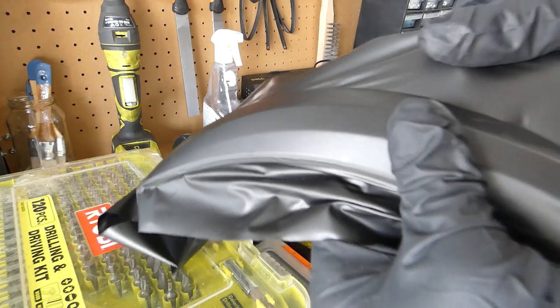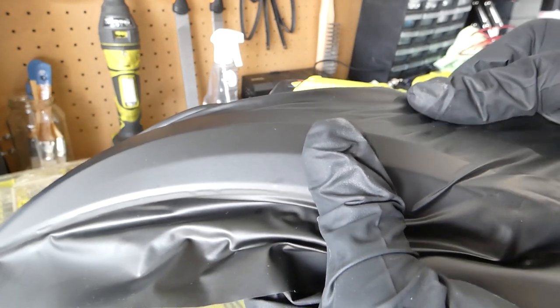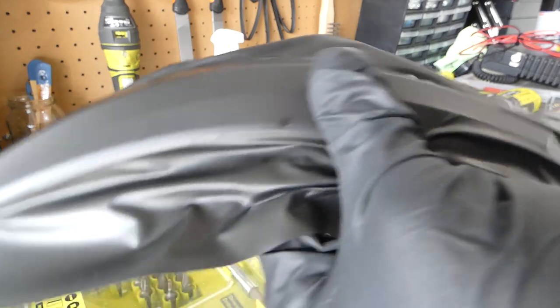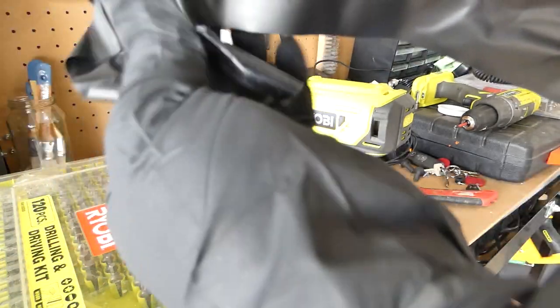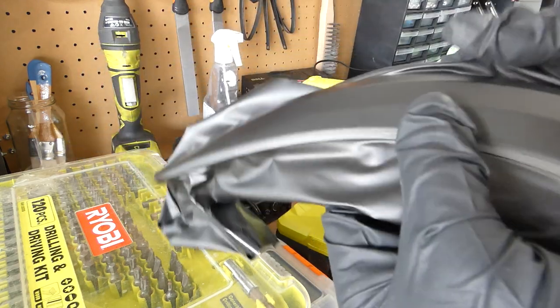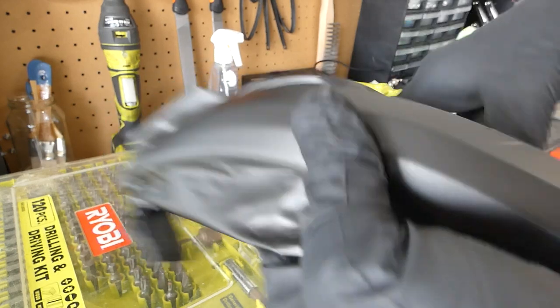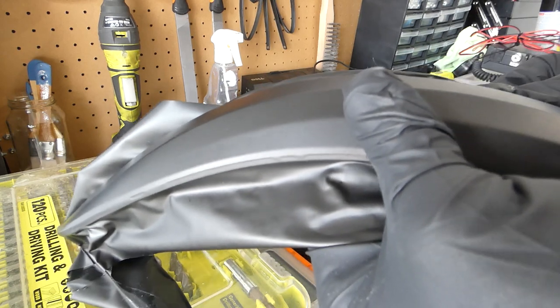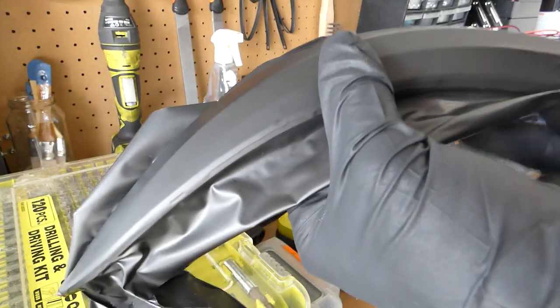With the bigger creases, not so much — just peel it off and try again. I probably should have heated the wrap up a little bit to begin with just to make it more mouldable and pliable, but we live and we learn. You want to pull it around so it makes a nice sharp edge — no creases. Pull it back on itself so it's creating a nice tight edge. Apply a little bit more heat to get these final creases out. That's looking heaps better now — pretty much done.